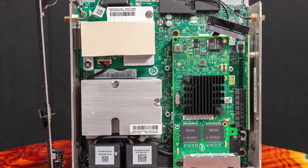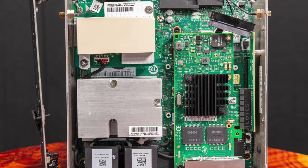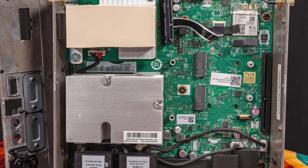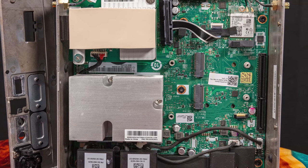Once you remove a couple of screws, you can get that out. Underneath you see a PCIe riser, and on the PCIe riser we have the Intel i350 NIC. This is a NIC we typically see in servers — definitely a high-end NIC. You get a lot of high-end features for a one-gig Ethernet NIC, and this is basically the best one-gig Ethernet NIC you can get in the market today. It's supported by just about everything at this point. It's also low enough power that Lenovo can just have it in here without crazy cooling like you'd need for a 10GBase-T NIC. The quad-port NIC is actually quite interesting, though you'd lose it in some configurations if you opted for CAN bus or something similar.